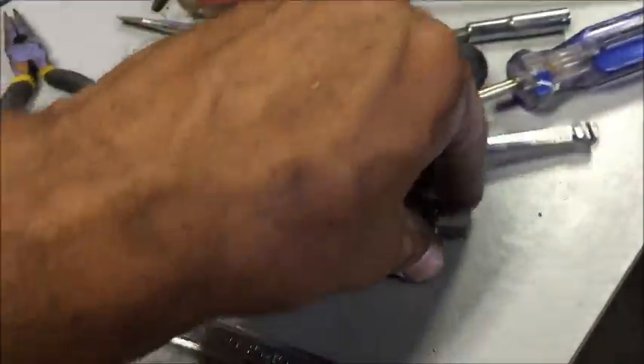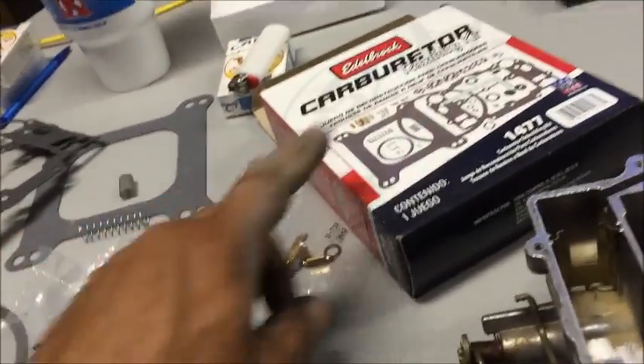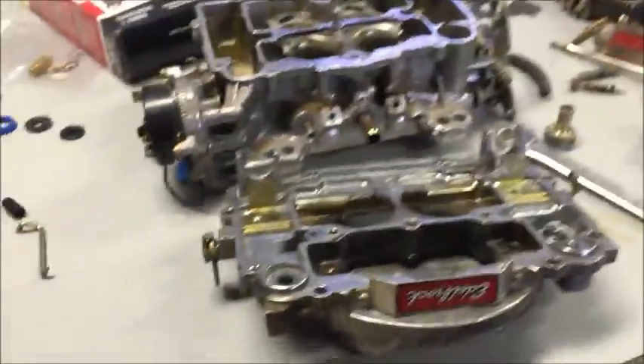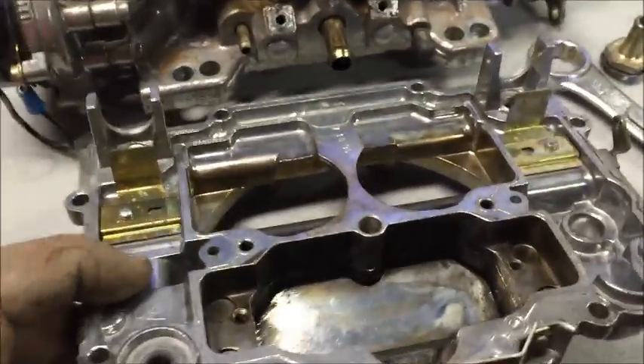So now we pulled those out. You can throw them away. Don't forget they got little gaskets on them that should come with them. Some of them, the older ones were brass and the newer ones were steel, or vice versa. I can't remember now, but this may be an older kit. So now we're just going to reassemble those in there backwards, put both of those ports in there. We're not going to worry about the slide plates, and a lot of times you pull those to clean them, but those look really clean. I think this thing was rebuilt and was only used a couple times after being rebuilt.